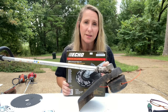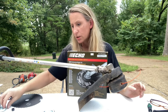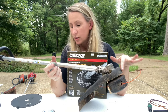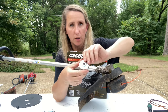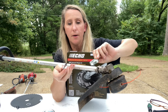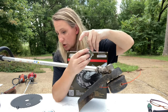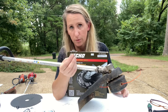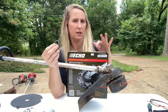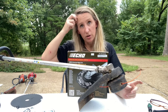Unfortunately the Echo requires you to buy a blade kit because it does not come with adapters to put a blade on when you get a homeowner model Echo trimmer. It doesn't have the raised section to put the blade on. You also need one of the cupped washers to protect your shaft, and you're going to have to have a reducer if your blade has a one inch hole, since the blade that comes with the kit is 20 millimeter.